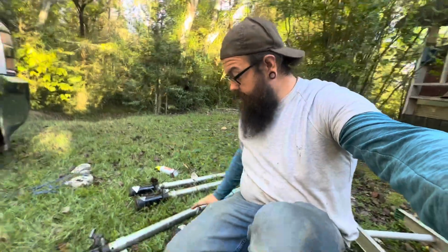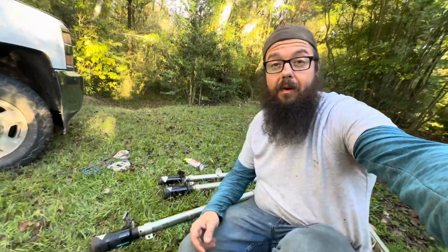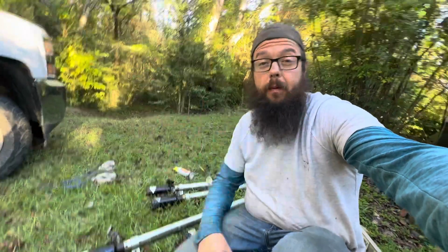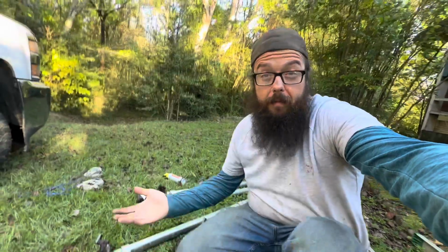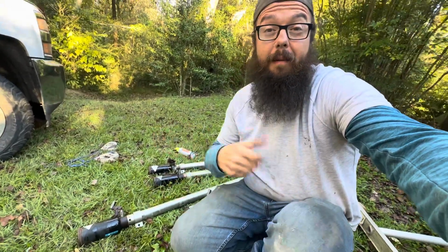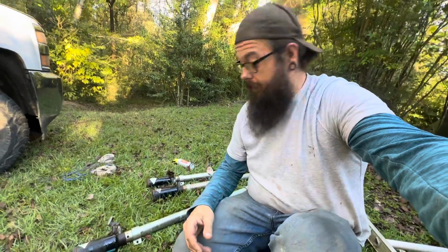One of the things I thought was very beneficial were these old school hydraulic jacks that were on a truck camper. Now, they are from a good manufacturer and they worked fantastic when we put them on the Love Hut. And they did so for about a week. And within that week, all the rubber gaskets inside of these things were dry rotted and they blew out because it was the first time they had been used in who knows how long. And they've been unfunctioning since then.